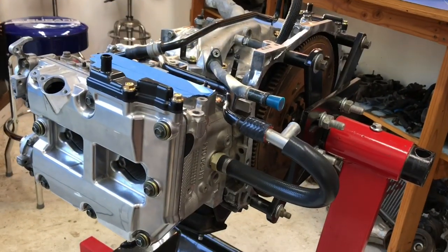It goes into the back of that cylinder number four port. When you introduce a negative pressure point — an exit port for the coolant — on the back of that cylinder number four coolant chamber on these Subaru heads, you actually introduce a lot more flow to cylinder number four, which will cool that cylinder. In theory, this could be solving one of the fundamental inherent design problems with the cooling system on these Subarus. This is a critical upgrade for any Subaru, especially one making higher horsepower or running aggressive fuel and ignition maps.